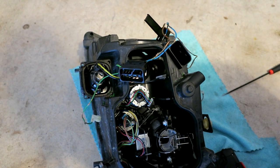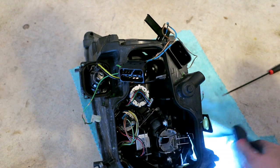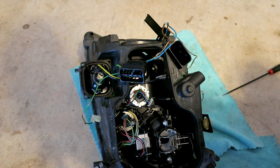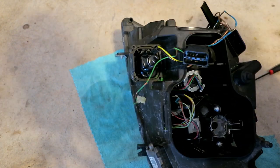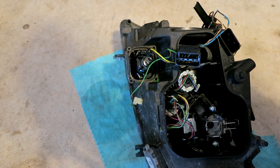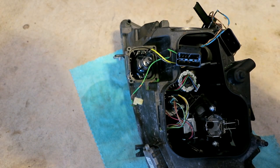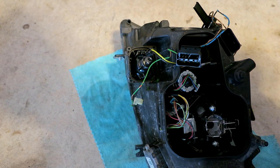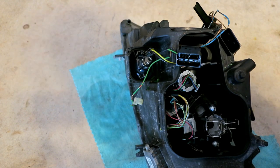It's a definite cost-cutting measure on whoever manufactured these headlights, because go look at the wiring on my E30, 30-year-old wiring almost, and it's like soft and supple still. Feels like silicone, like a rubbery silicone soft coating versus this hard plastic. I've seen this before. I used to have a Contour ages ago. And it's just basically cheap wiring, cheap insulation that causes this. And I don't think it's acceptable for the cost, given how much it would cost to replace this headlight. But, you know, it is what it is. I gotta fix it now.